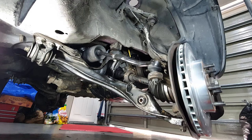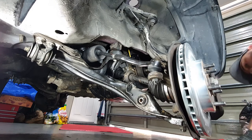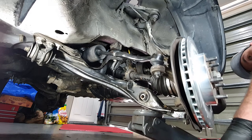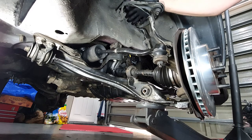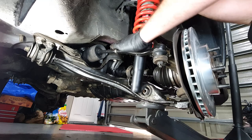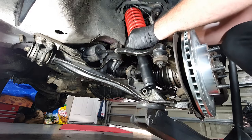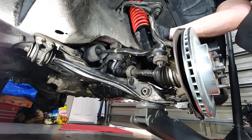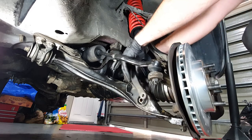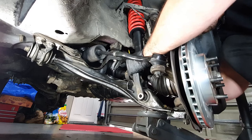So we've got our lift springs fitted to our new shocks, so let's chuck them back in. This is the reverse of removing them, obviously. The only difference is you're probably going to need a floor jack just to get this arm up a little bit — just to make it easier to fit through this gap here in the arm, because as this drops down it kind of constrains what you can fit through. Down first, and then back up. So now I'm just going to finger-tight these nuts on the top just to hold it in place, and then raise this back up like that.